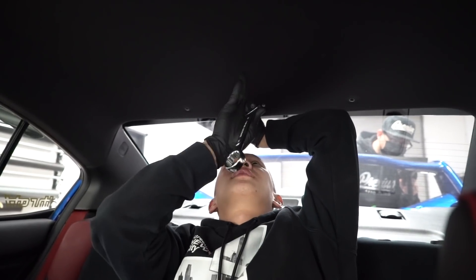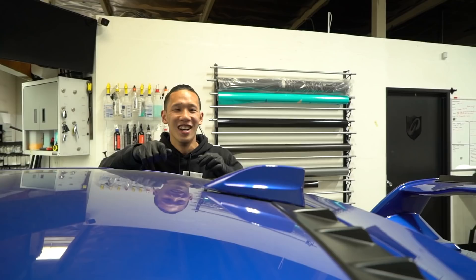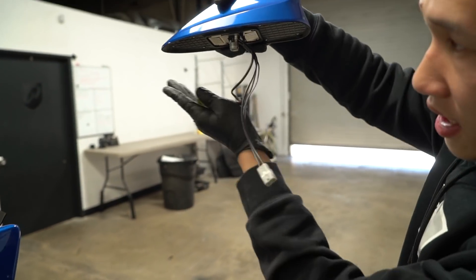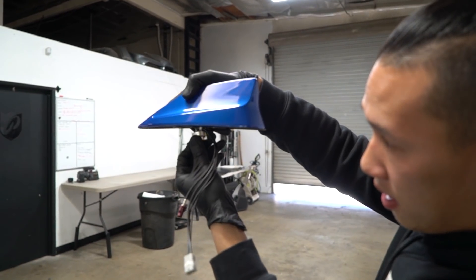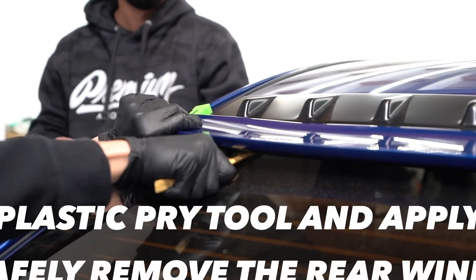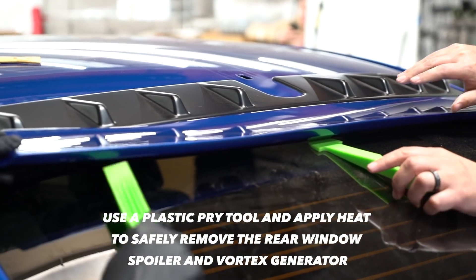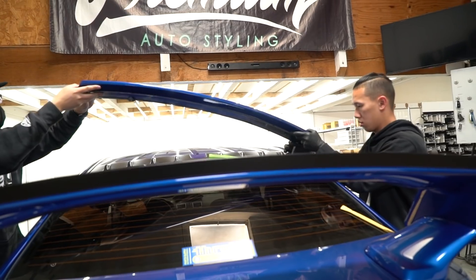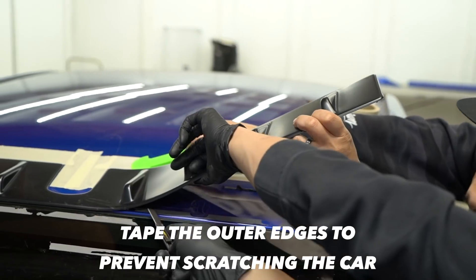You want to pull the headliner down, reach in, and you're going to need a 7/8 wrench at least this long because the bolt sits right here. Here is the 7/8 bolt on the inner side of the headliner — so there's going to be one 7/8 bolt in there and then two connectors up there. Now we're going to the top side to pull out the antenna. There are two connectors right here. I disconnected two wires and the bolt sat like this — you just pop it off and the antenna comes right out.